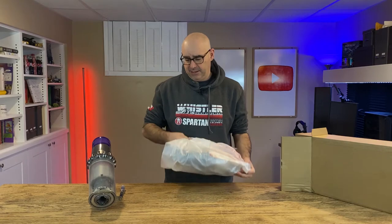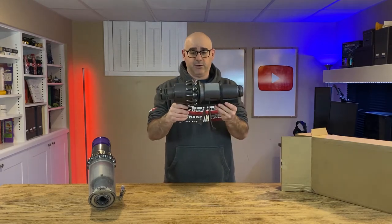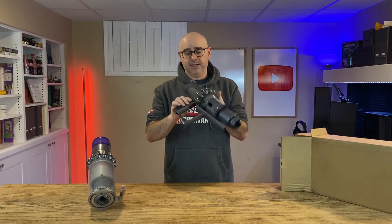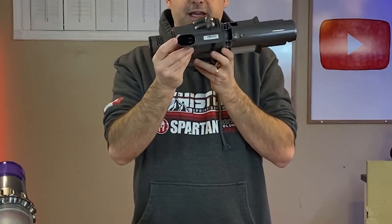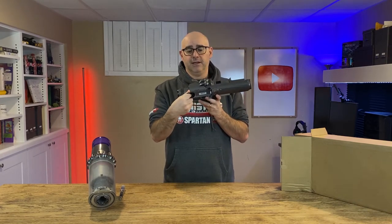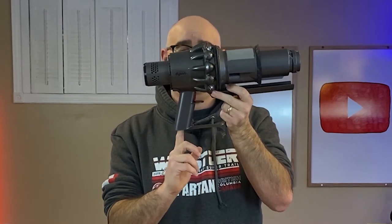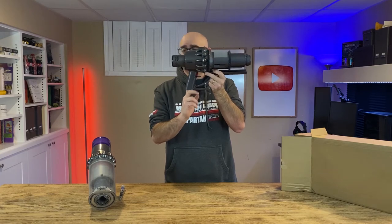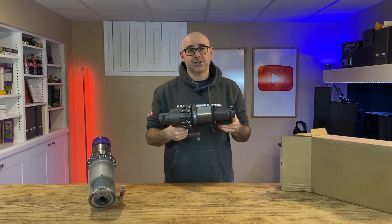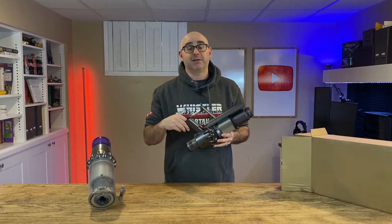You can see it has basically the whole body again. It's missing the filter, it's missing the cyclone tube, it's missing the battery — but the switch is in here. Interestingly enough, if you look down inside the battery port, there are the two electrodes as you'd expect, and then there's a little red piece of plastic you can clearly see. If I poke up on that piece of plastic, it moves the trigger switch. I don't know if there's actually an electrical switch inside the physical connector, or if maybe that's all located within the battery and the problem is related to the plastic button itself.